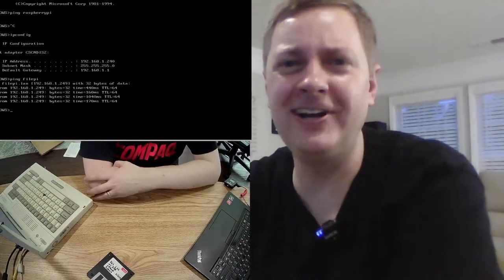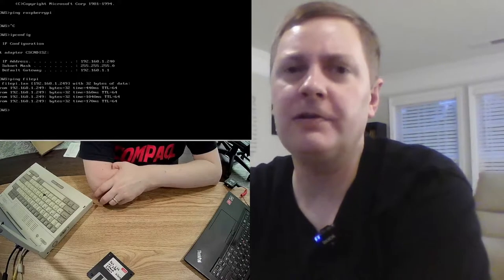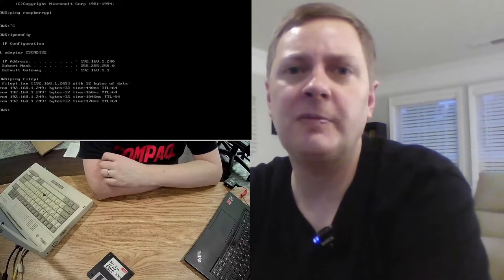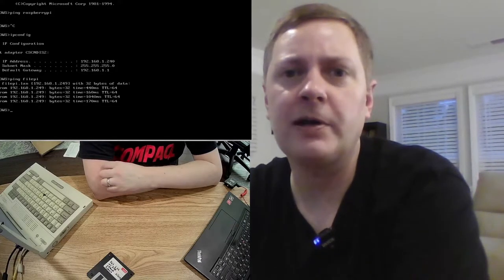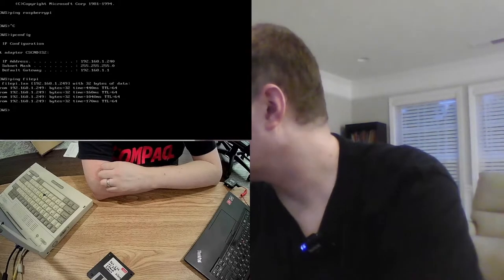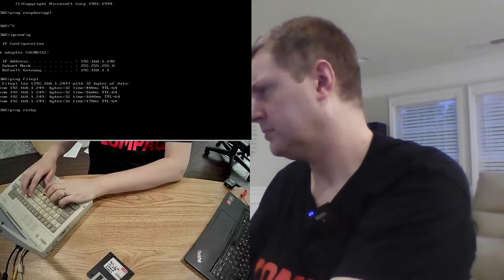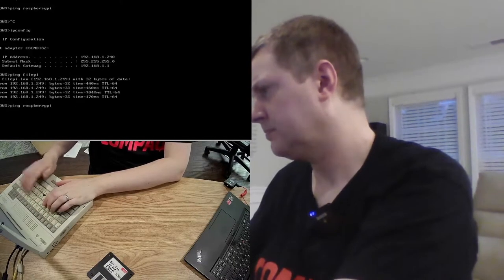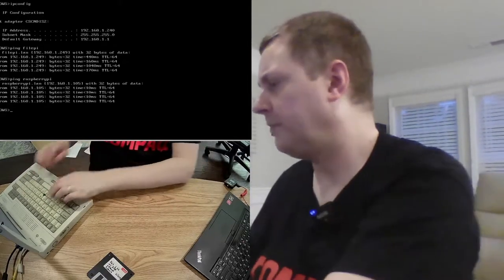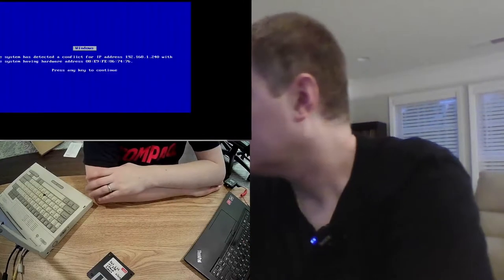Well, that's no good. What I have found with the Raspberry Pis is if you configure them to have both wired and wireless networking at the same time, it'll have fits. I should mention this when I make that video. So, am I just misspelling it? Weird. Okay, there we go. I guess it just took a minute to resolve. So now if we do a dir Z drive, do we have data? Yes.